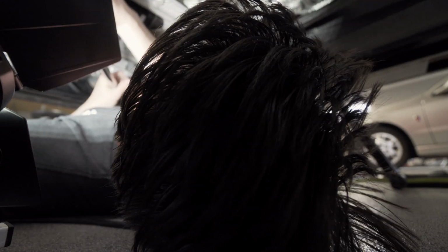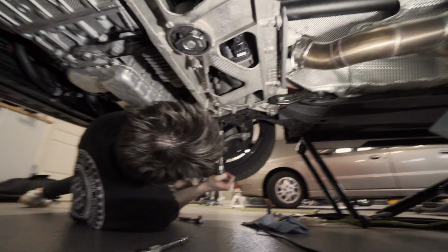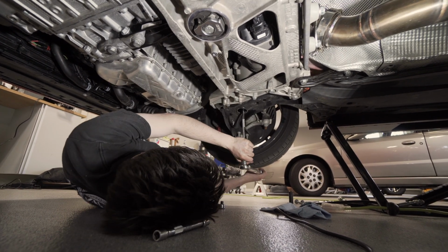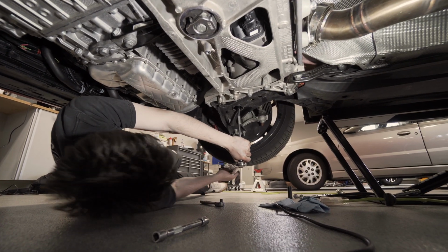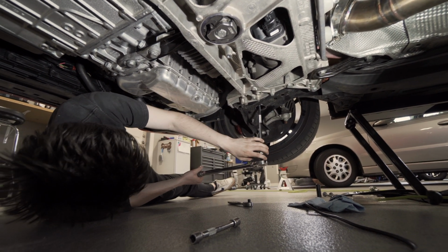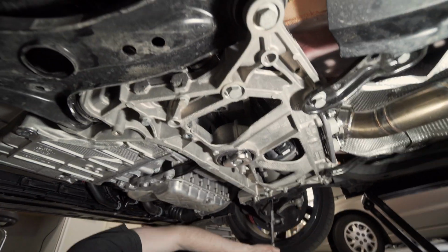180. Beautiful. So once you get the rear subframe bolts, you get the front subframe bolts, just kind of by the wheel well. Torque that to 70 newton meters or 51.6 foot-pounds plus 180 degrees, which is what Dan's doing right now. Attempting to do. And we will torque down this Dogbone.